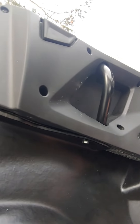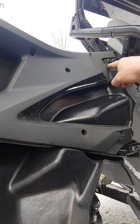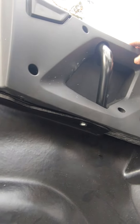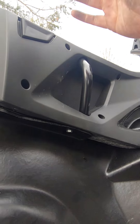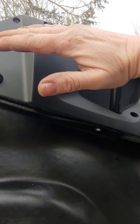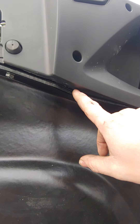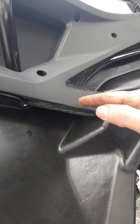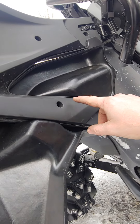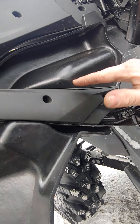It's the only way it will fit because it's designed to go on top of it. But this is sandwiching everything to the bracket, which pulls the outer door skin up higher, putting this out of alignment and putting everything else — all your holes — out of alignment. So I start at the back because of this — you've got to get that in behind. Then do your bolts. Mainly focus on lining up all the holes, not on getting the clips in, because you can play with that all day. Getting the clips in from the top, work your way down. As it's pulling in, it's forcing the panel down because the screws are lined up, putting it in the location it's supposed to be in.